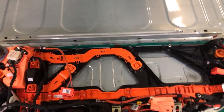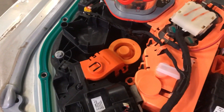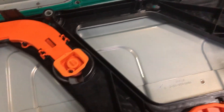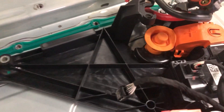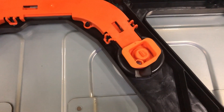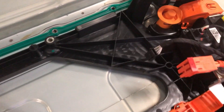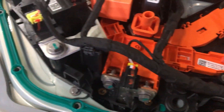I got the charger removed, and this is what we're left with. Very similar battery architecture, it looks like. So what we have is battery positive post here, negative on this side, coming up to the two contactors. It does run the length of the pack, comes back through this terminal, pokes up. That's our high voltage disconnect that splits the pack — pyro fuse. Back down through this side, then pokes up at the positive contactor. I metered between that positive post contact and this half pack and got about 186 volts DC — relatively high charge in this pack still.